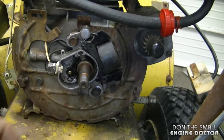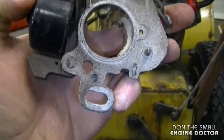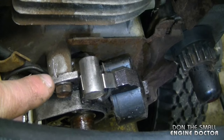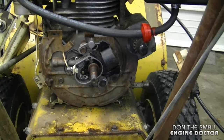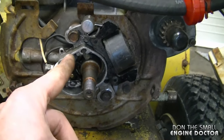Here's another magneto — you can see that the holes are very adjustable. So if you do take it apart, you can take a picture first with your digital camera, or you can also make a lining mark with a chisel or with some paint, and then when you go to put it back together you know exactly where it was before. But if you didn't have any marks whatsoever to line it back up, just put it in the middle.